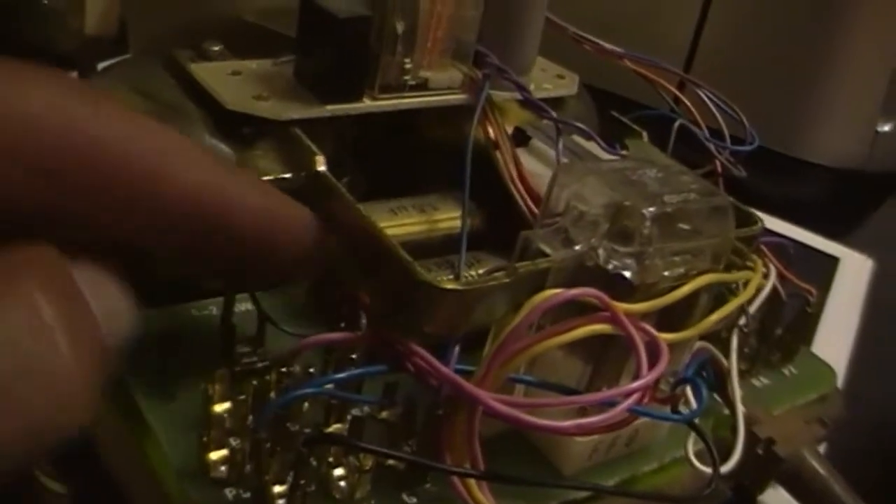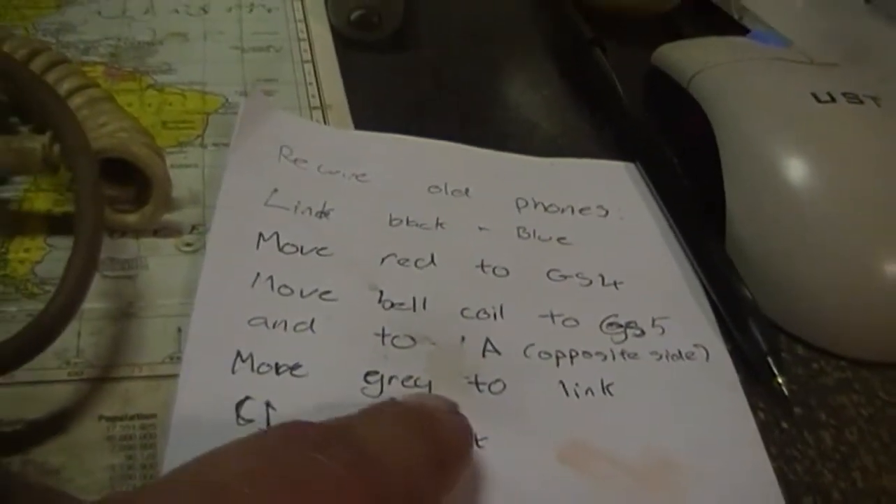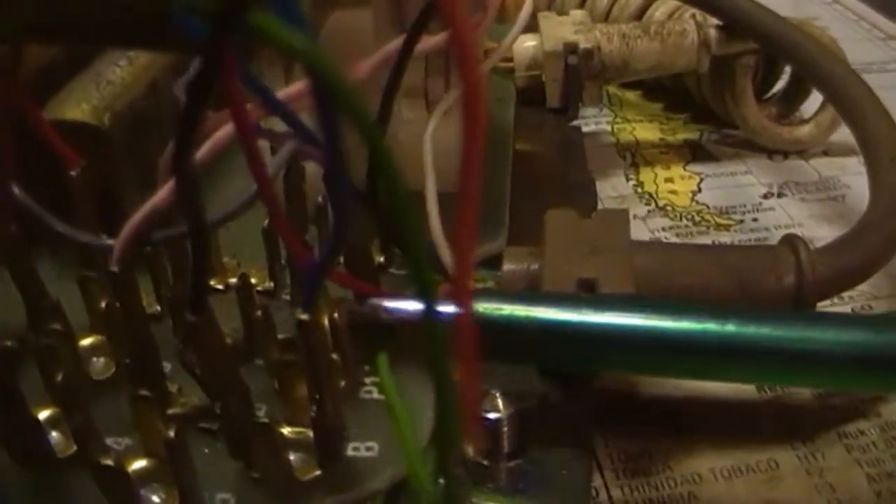We do have the cordless ones but they don't work. Anyway, the wire I missed - I had to pull off and check because I didn't write it down - was to move this little link cable between C1 and GS4. So I've added it to the list. I might add this list to the description underneath the video in case it helps someone try and fix one of these phones. So it's move grey - grey to link C1 to GS4. I haven't quite done that yet in here, I don't know if it applies, so let's see how we go.